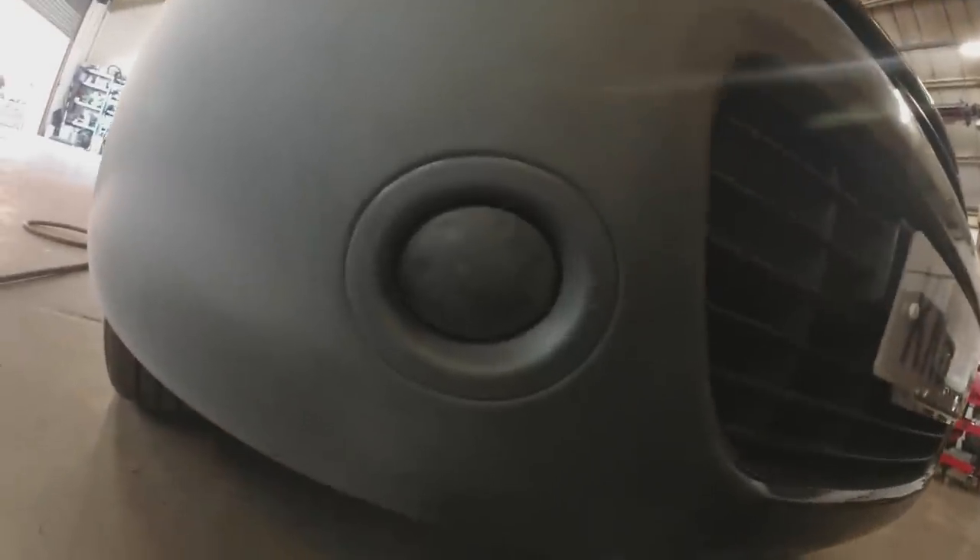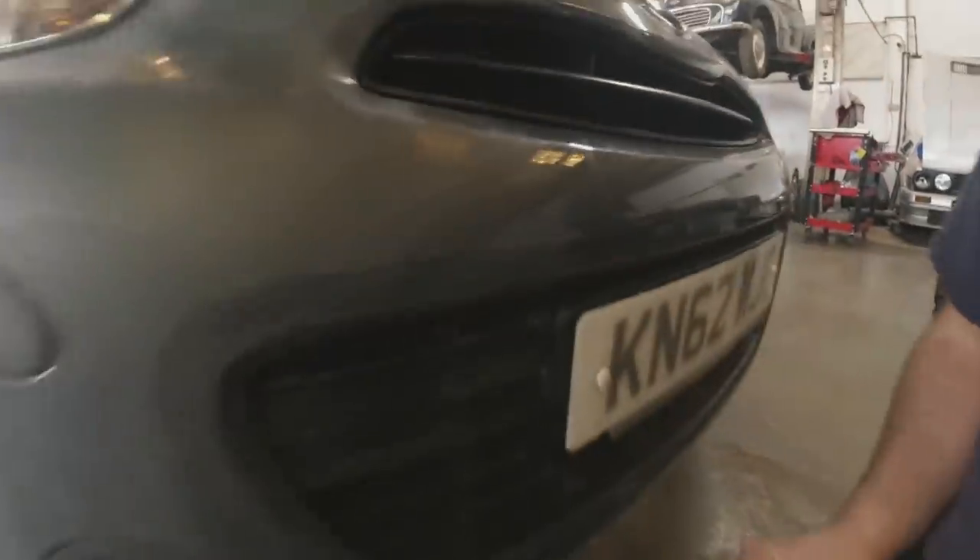So we're all keyed up, with major attention spent on the areas and the little grooves here, because that's where your paint is going to flake off if you don't get it keyed up properly. Now it's time to mask off all the areas we don't want to paint on. Note that I've folded the tape over here so I don't have a hard edge when I'm spraying - just fold the tape back on itself so you don't have such a sharp edge.